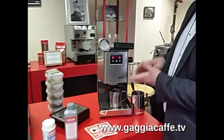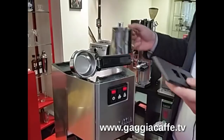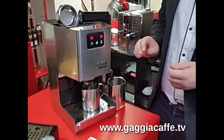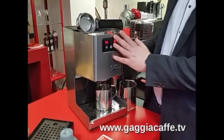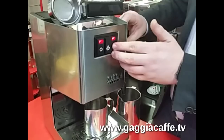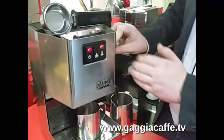Dissolve the powder, put it in the water tank using your jug, pour it in the top with the liquid already dissolved, and fill your water tank up with cold fresh water as well. Then all you're going to do is turn your machine on and see if you can get the hot water and steam function through the steam arm — press your coffee button and then quickly open your steam arm on the right-hand side.